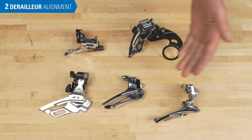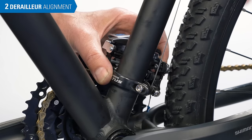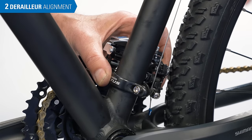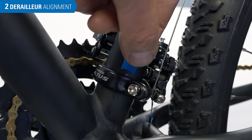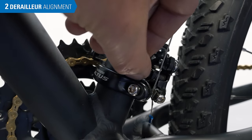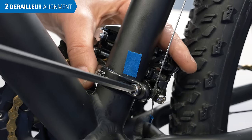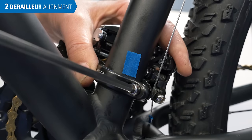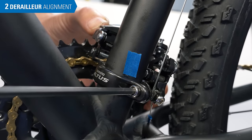Manufacturers have different mounting systems. Clamp style derailleurs allow both rotation and height adjustment. However, before making adjustments to clamp style derailleurs, a tip is to make note of where the clamp is on the tube. Loosen the mounting bolt and move it up or down as needed, keeping in mind any changes needed in rotation. Secure the mounting bolt and inspect the cage.